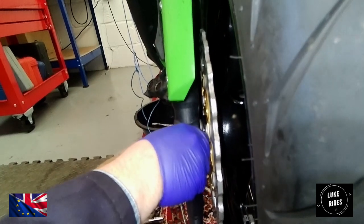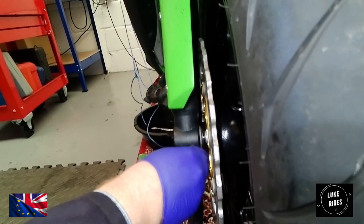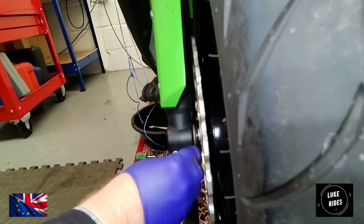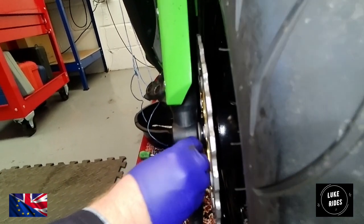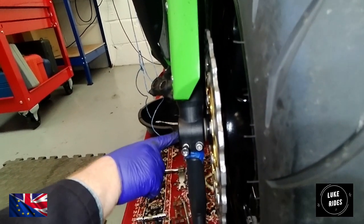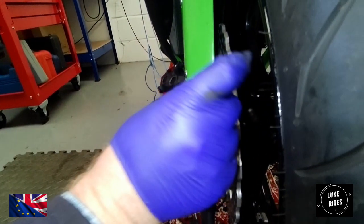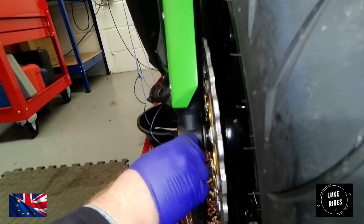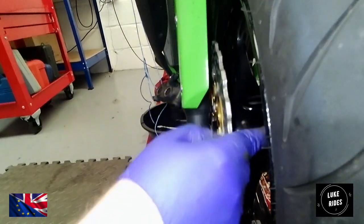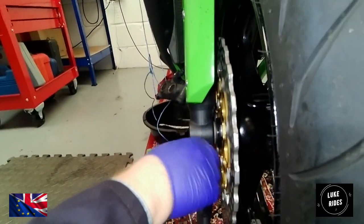Now there are pinch pins on the other side, and I don't usually undo them, because they're holding the other side of the spindle. This part of the spindle is quite long, and then there's a short piece. If I undo the other side, the short piece gets loose. So as I start to undo this one, that one rotates, and I can't get the spindle out.